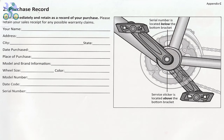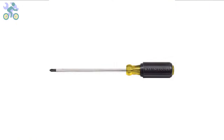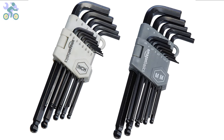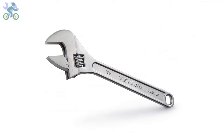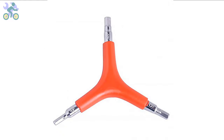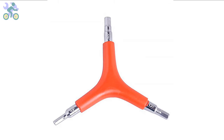To assemble this bike you will require the following tools: a Phillips screwdriver, preferably size 2; wrenches in sizes 10, 13, and 15 millimeter; and allen wrenches in sizes 4, 5, and 6 millimeter. If you don't have the specific 10 and 13 millimeter wrenches, you may use an adjustable wrench instead. However, it's required to have a 15 millimeter open-end wrench. I generally recommend using a three-way allen wrench with sizes 4, 5, and 6 millimeter, as these sizes are commonly used and can endure significant pressure during assembly.